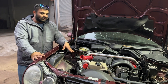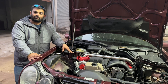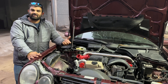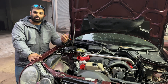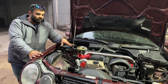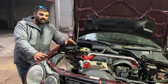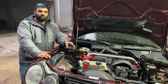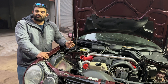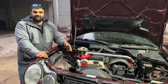We are also in process of finalizing a three-inch almost straight-pipe exhaust with a single resonator, which is going to complement the increase in power and the exhaust outflow. That work starts in a couple of days once the turbo install is over. We should be cranking the vehicle by tomorrow on the same pump, and after it has started and is running smooth, we will be upgrading the pump as well. In the next video you can expect to see the dismantled pump and the installation of new elements.